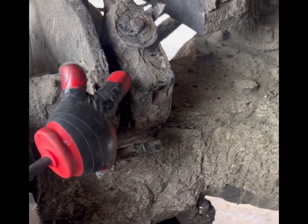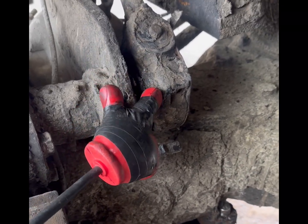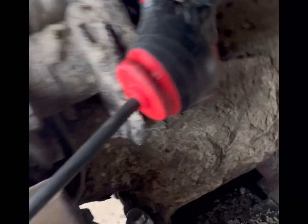It will chew off the end of the keeper and all that stuff on the end here. What happens is it gets jammed up inside the slack adjuster. So you have to cut it off if you don't want to sit here all day trying to beat that out, because it's all ground up on the inside.